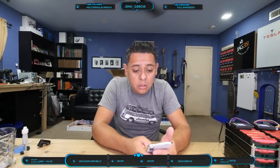So I got the Power Tech on 1000 watt inverter. My window unit draws 480 watts and it trips it. What do you think? Well, it might be because of the startup, right? Is it 480 watts continuous, or that's when it starts up? Because most of these things have a huge spike, and if I show you my unit, it has a huge spike.